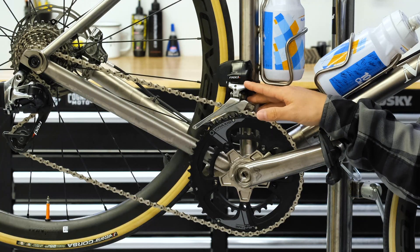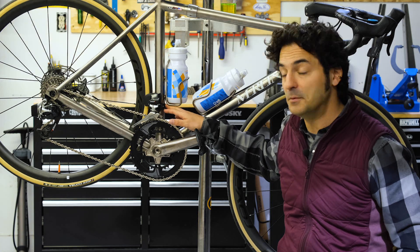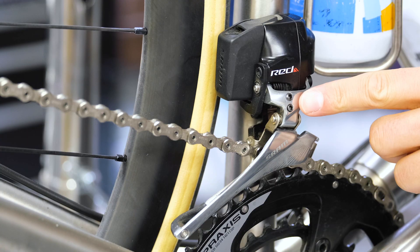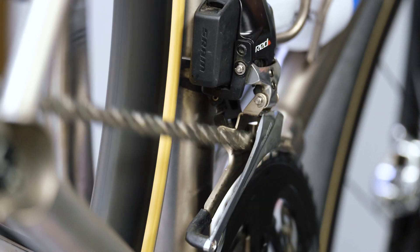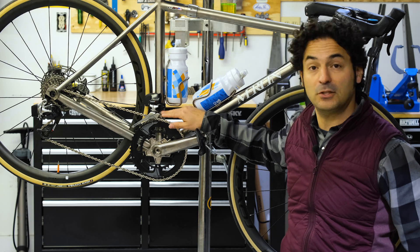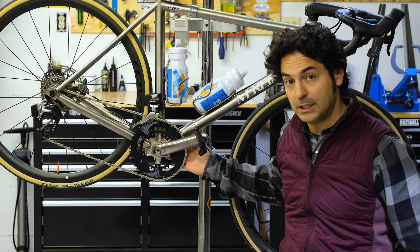The arms are connected to the main body of the derailleur which is in turn clamped to your frame. To adjust how far the cage can move inboard or outboard you have these two limit screws. Turning these limit screws will either prevent the derailleur from moving too far outboard and kicking your chain off, or in the opposite direction — the low limit screw — it will prevent the chain from dropping off into your bottom bracket shaft.